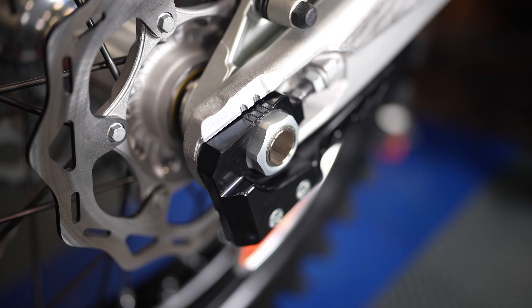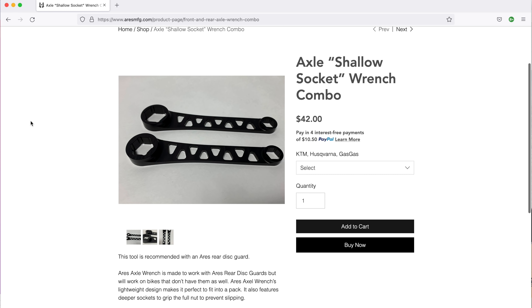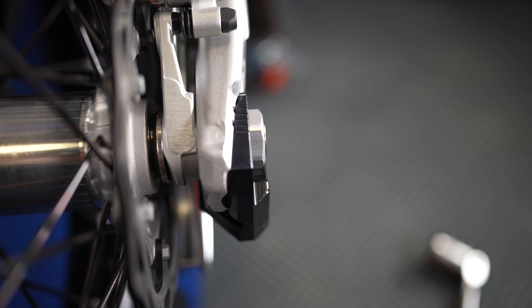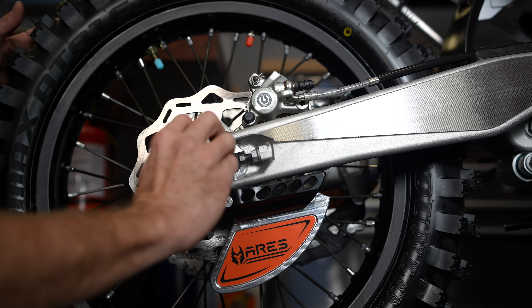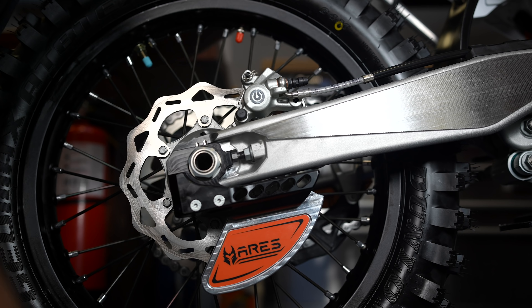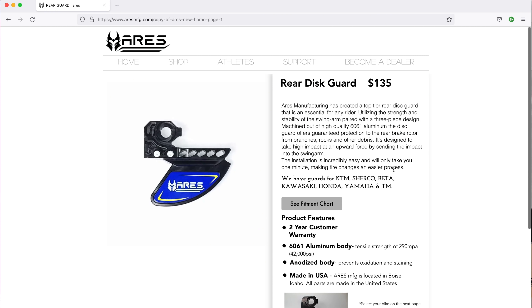I haven't used this product yet, but I can tell it's built like crazy — it's awesome. Is it going to be absolutely as strong as a solid piece that integrates the entire brake disc? I don't know. But this thing is the same size as the standard adjuster, so when you pull your axle block adjuster off and put this on, it's the same dimension. Just screw your axle nut back on and you're installed. The only minor concern is that it takes up a little room on your axle so you can't get your socket on quite as deep — they actually sell a wrench for your tool pack for that reason.